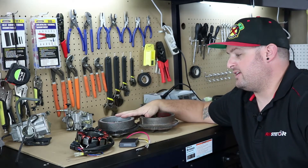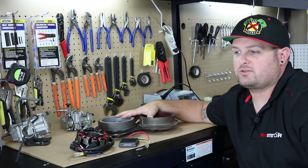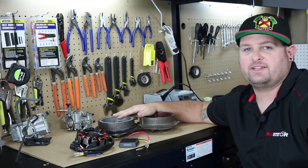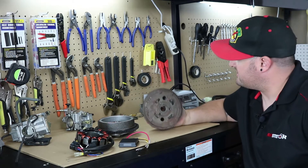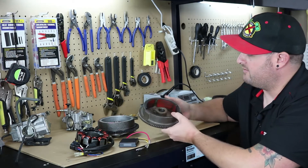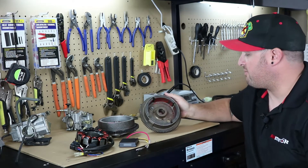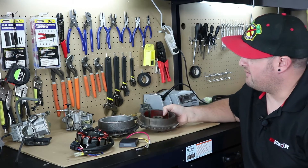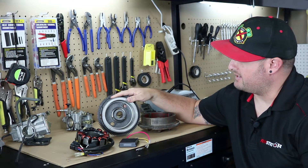This is a really nice upgrade. There's a ton of these Polaris Sportsman 500s, the Scrambler, and a bunch of other ATV models — they all use this Polaris FF97 coated flywheel, a ton of them. These all have a problem with the magnets coming loose, which is really common, and we have a great fix for it with our new flywheel with sealed magnets.